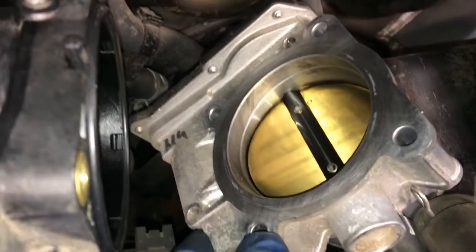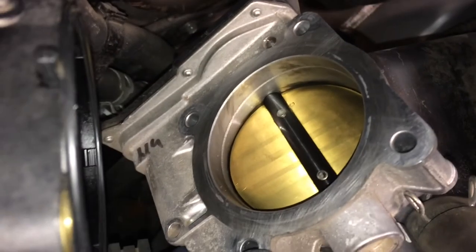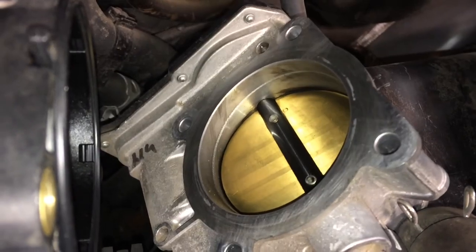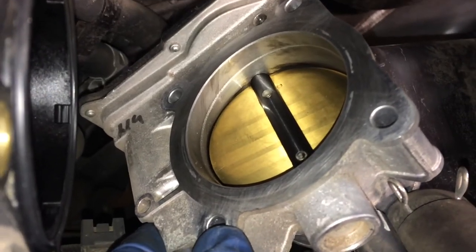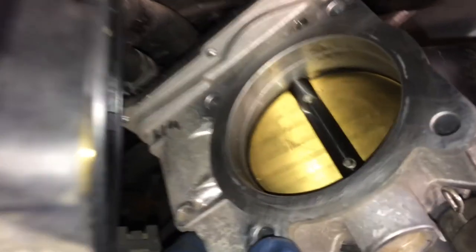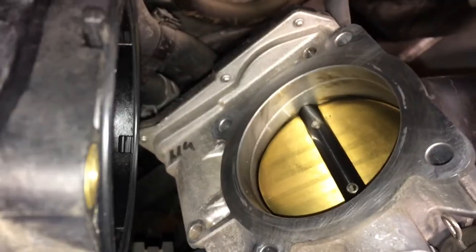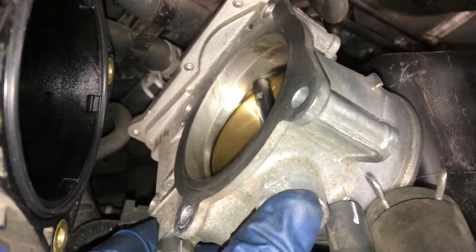Don't move the valve. If anybody knows better, please leave a comment, but it's my understanding that you're not supposed to move the valve on these electronic throttle bodies while it's disconnected, because you have to reset some sort of TP sensor. So just don't move it, just wipe around the edges if you want to do it, and then of course you can do it on the other side.